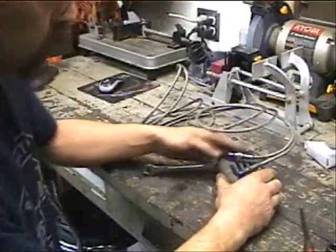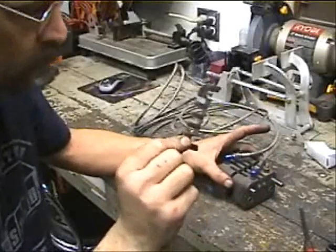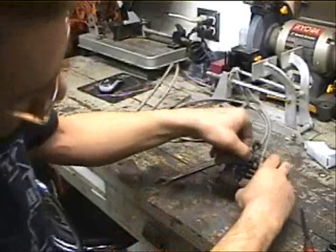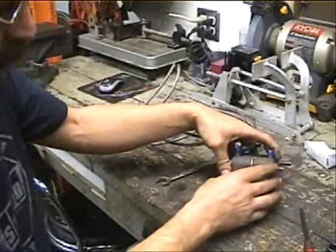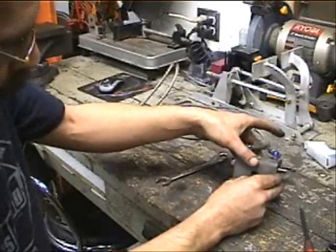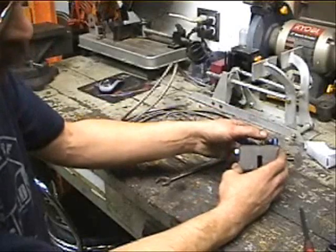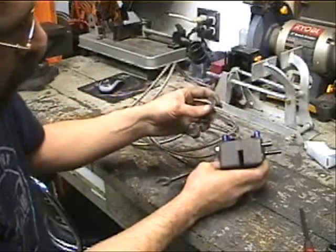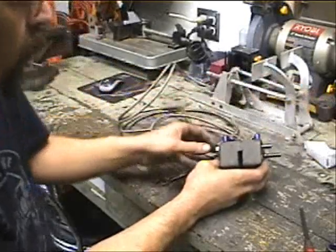You've got your bolts out, you've got your shim spacer — goes in between the two caliper halves. These two little notches right here fit right down over the bolts. It helps give you a little clearance for the new NHRA requirement, since NHRA mandated the use of a quarter inch thick rotor a couple of years ago. There's just enough room for a quarter inch rotor to fit in here without this shim, but it definitely gives you a little more clearance and wiggle room.